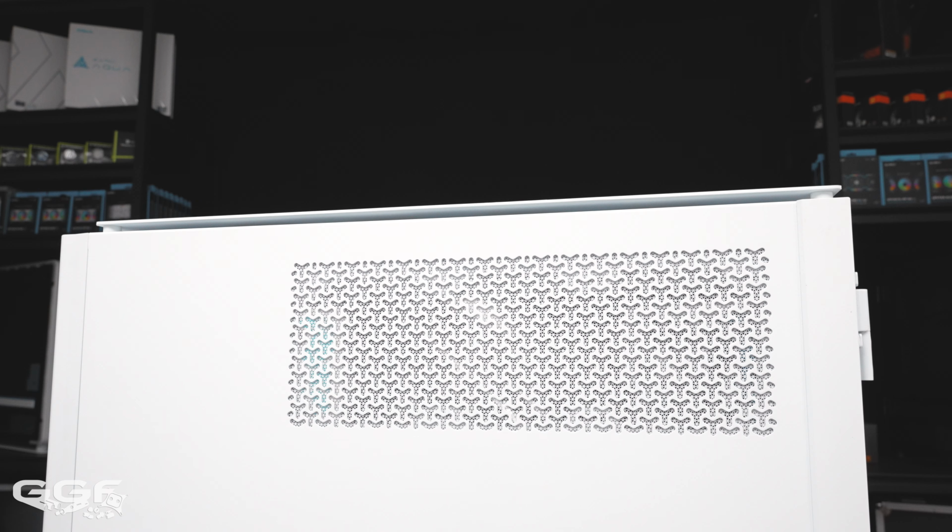The top radiator clearance only really applies to those wanting to run 480s at the front and 480s at the top, as there are going to be some clearance issues here. For 360s and lower, no issues at all, as there's a whopping 150mm here to play with. If going quad 480 radiators with my test Corsair Hydro X Series XR7 480 in its upright position and the top rail clips in their default position, I had exactly 60mm of clearance here.